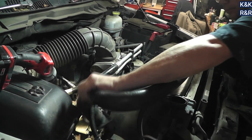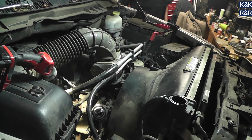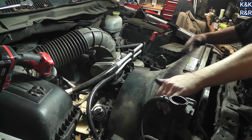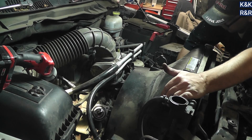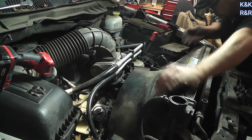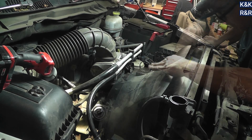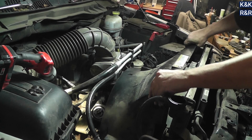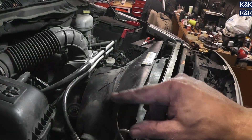If you do replace a water pump on these, it's kind of advised to just replace the fan clutch with it, because these don't normally fail like that. Normally a water pump starts leaking because the bearing has walked forward to where fluid is coming out the weep hole, letting you know you're about ready to shear a shaft — and it does happen. I don't know if this has a plastic or metal impeller. I've done a ton of water pumps and the last few years I've seen them go to plastic impellers, which I think is dumb.